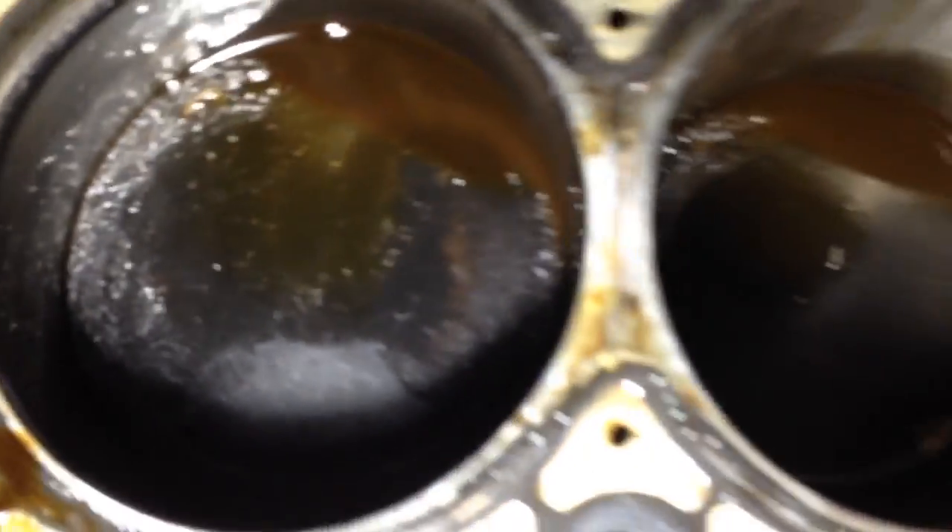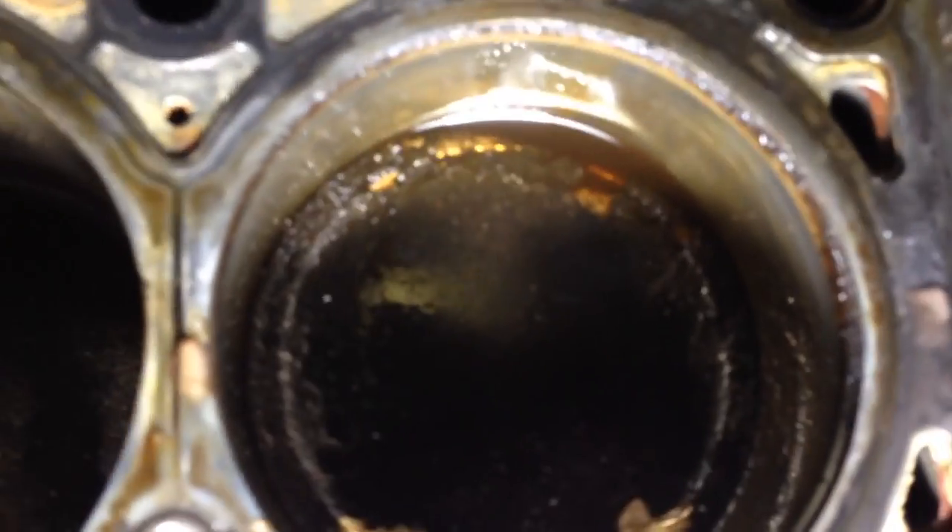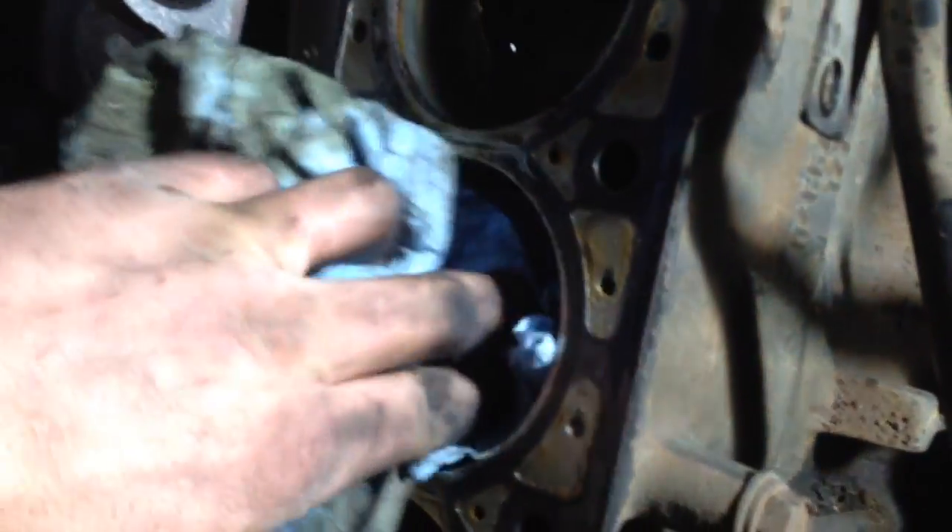Those are wasted. Now this one should be fine, this one here is good — I pressure tested them too, so I know from other means before I tore it down which ones are good and which ones are bad. But back here, I want you to notice as well — if you can see those marks, those are exhaust valves. They're bent there. Let's just clean out a bit more oil here so we can see. I think this wiped out the majority of the valves in the entire engine, quite frankly.